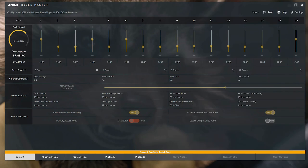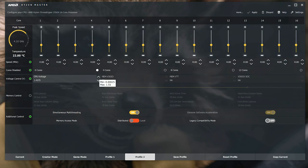Let's get started on the Threadripper overclocking. If you're new to overclocking and you want to just play around, see what you can do, and not worry about dialing settings that could possibly damage your hardware, I highly recommend the AMD Ryzen Master software directly from AMD. You can play with things without worrying too much about damaging stuff. Its highest core voltage is 1.55, but in order for me to get my Threadripper to 4.2, I had to go to 1.65.